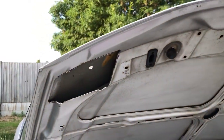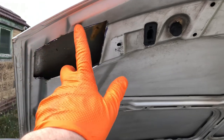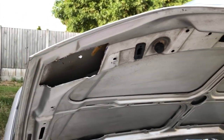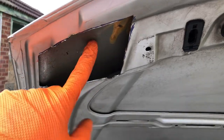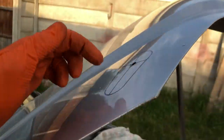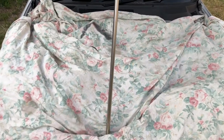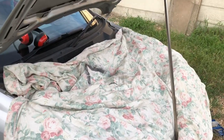That's cut out now. When I cut things I always try to follow the lines of the body - you can see I used this little section here, went up to a line of the body, and now the jigsaw isn't going to catch on anything and it'll be a lot easier to cut this section out. Whenever you're grinding or cutting over your engine bay, put a sheet over it - you don't want all that nasty dust getting over your engine. It gets in places you don't want it, could get into plastic connectors and melt things if the sparks get hot enough. Always cover up your engine bay.